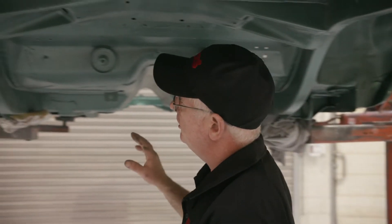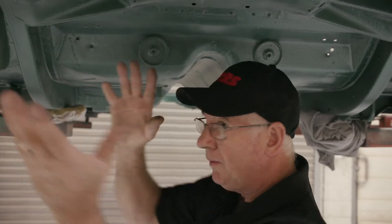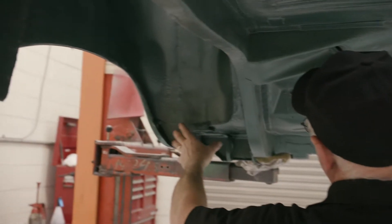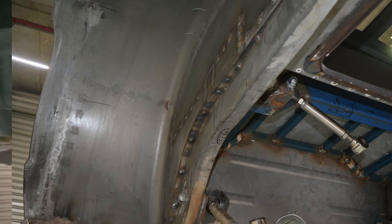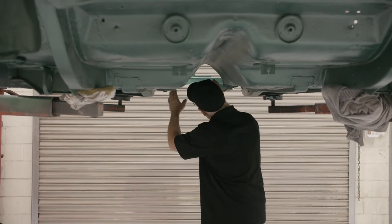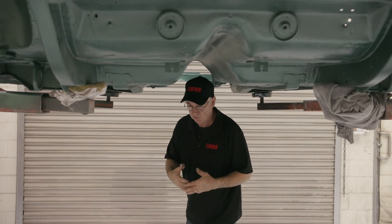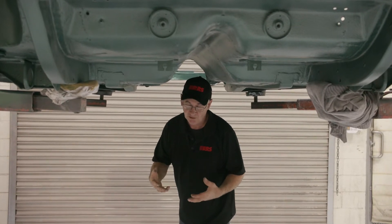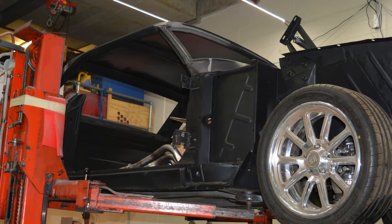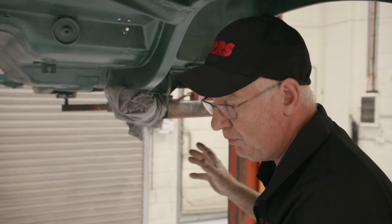I'll just point out some of the things that we had to change on this vehicle to get everything to fit: the floor from this point all the way back to the rear tail panel, including putting on the tail panel, the wheel arches inner and outer, the rear quarters, drop down panels, and the transmission tunnel all the way through. And a donor firewall, because the firewall had been taken out and a recessed firewall put in that didn't allow room for air conditioning, heated demister, the wipers to operate correctly, or even enough room for wiring. There was no consideration of how the hydraulic clutch would work. So all of that has been rectified already.